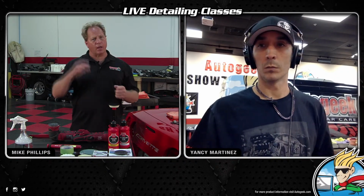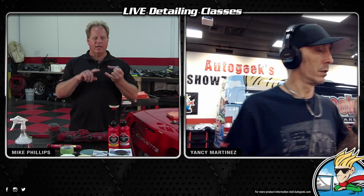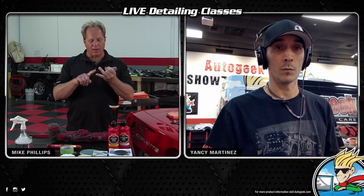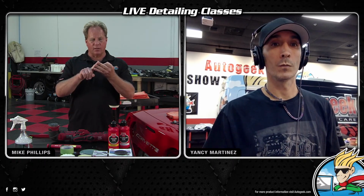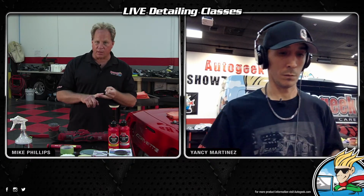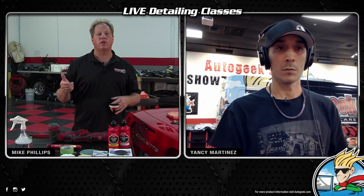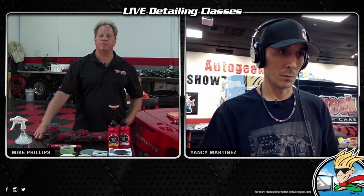And you always got to remember, and I got an article on this, here's the title of it. You like it? A long title, it's really boring. You could type this into Google, by the way. Sanding removes paint, compounding removes paint, polishing removes a little paint. Type that into Google, add my name, and you'll find the article, but that's also what the article's about. Sanding takes off paint, compounding takes off paint, polishing takes a little paint off. Problem is if your paint's real thin, you're going to go through. So working on old single stage paints, I'd be very careful.